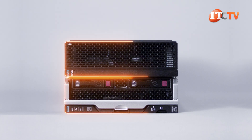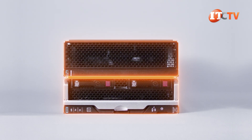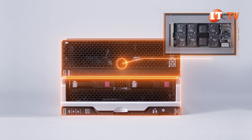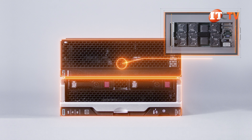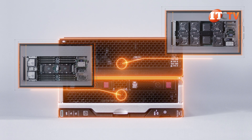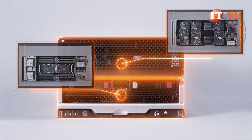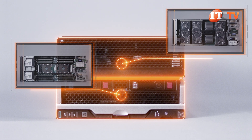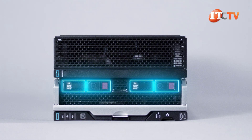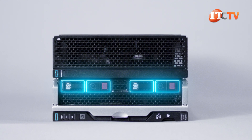As you can see on the front of the node, it looks like two systems stacked one on top of the other, and that's exactly what's happening here. On the top, you have the Graphics Mezzanine, which houses the MXM computational accelerators. On the bottom is the Compute portion of this node with two 2.5-inch drive bays in front, which will support either SATA natively or SAS drives with a discrete RAID controller. Also supported in the front drive bays is a unique SFF flash adapter that supports two UFF drives in each carrier.